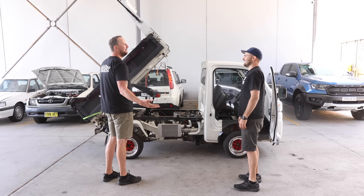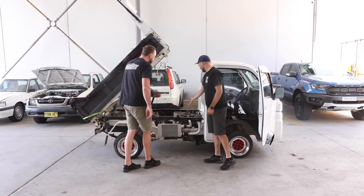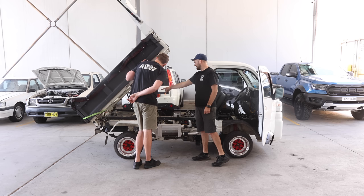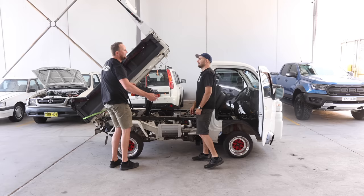Hello there, mate. Hello, Scotty. Fancy seeing you here. I feel like I know this beast already because we've talked on the phone so much — first time in real life, though. Turbocharged, intercooled, KFDE 3-cylinder, 0.6-litre engined K-truck. Our fuel system's up there with a Haltech flex sensor on it, fuel pressure regulator with a vacuum signal going back to it, and a fuel pressure sensor in it. I remember speaking about all this — you told me I'd have to get to the tank because it's not return.